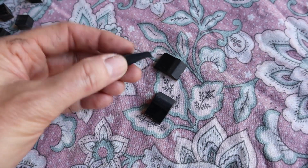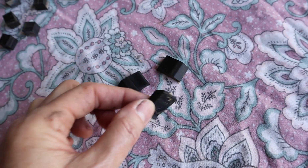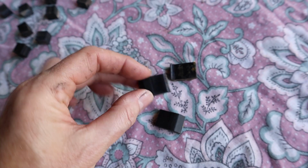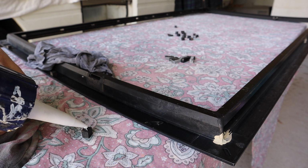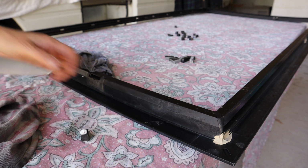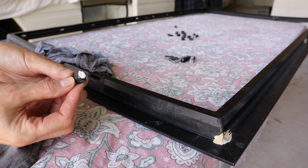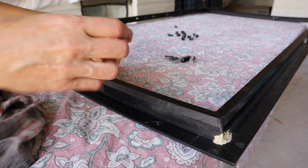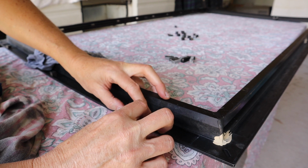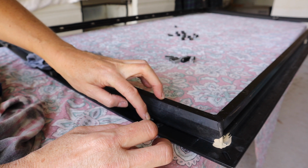There's also a few of the windows that have this different kind of shape block along the bottom edge as well, and you can see a few of those have fallen off in the process of taking out the window, so you just need to be careful and keep an eye out for those as well. So I just went around and stuck all the loose blocks back onto the frames using a bit of Sika. I'm using Sika 221, which is just what I had already. It would have been much better to use the black Sika rather than the white, but I already had a white can open and I wasn't going to go get a whole new tube of Sika, which is quite expensive, just to do this little bit. If there are any bits visible at the end, I can always cut the excess away once the Sika's cured.